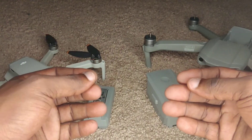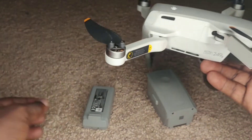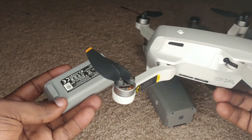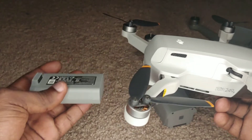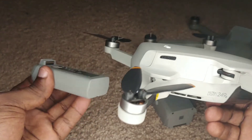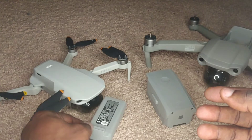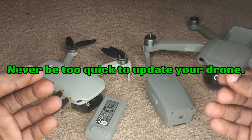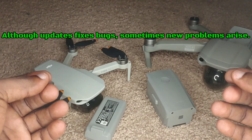It's also important to update the firmware for these drones. When you do a firmware update, you don't just update the firmware on the drone itself — you also update the software for the battery. The battery communicates with the drone, so you need to make sure both are updated. My rule of thumb is: when there's a new update, I check forums to read people's experiences before updating, because sometimes after an update you end up with more problems than you started with.